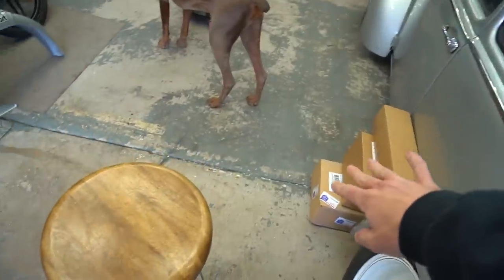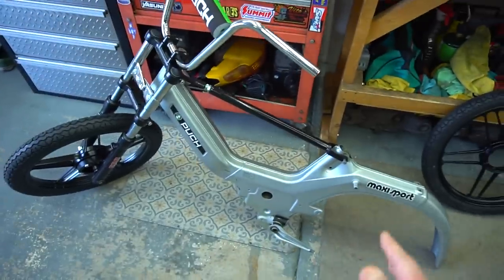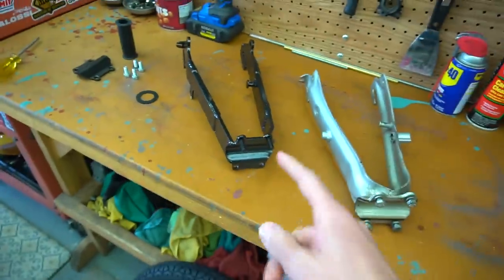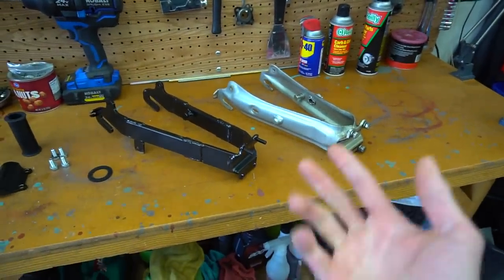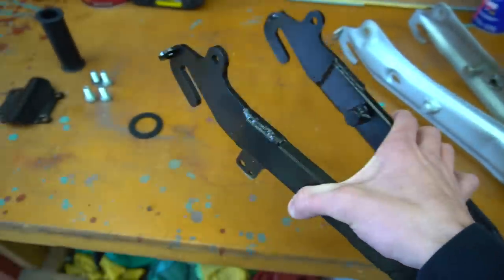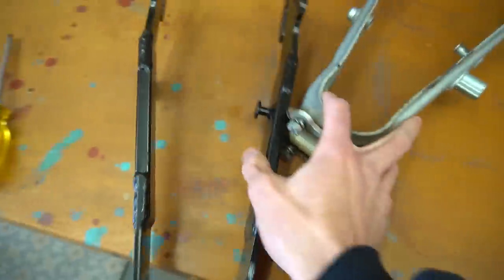We got more pieces over here and up here as well. Very excited to be working on the rear disc brake setup, as well as our upgraded swing arm to go along with it. This is going to be big, especially for wheelies — when you have all that weight on the back you don't want any play. It's actually kind of dangerous; you could probably bend it and the wheel would jam. There are some things we might have to modify to make it work with the disc brake setup.